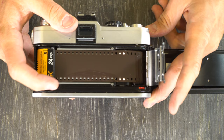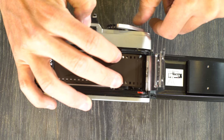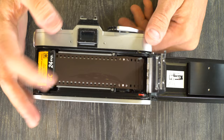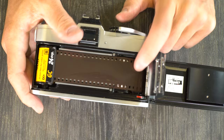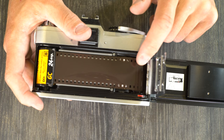Whenever you trigger the shutter, film gets taken up and the quick-load system keeps tension on the sprocket holes so the film advances easily. There's no pulling back because this is not letting the film move backwards. Also noteworthy: the film is wound in the same direction here as it is coming out of the cassette. Most later cameras wound it in the opposite direction. This allowed the film to retain its natural curl, and professional cameras into the 80s and 90s wound film this way as well.